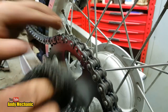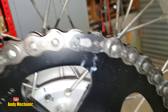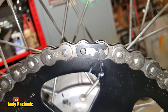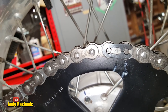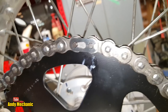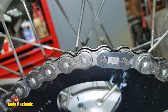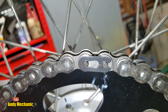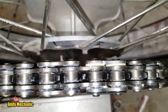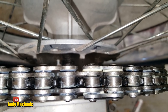And it's important that you make sure that it's in place. So let's have a really good close up. All right, bit of freehand, here we go. Is it okay with the light on? I think it is. Yeah, you can see really well what's going on. So that is bang on. It actually helps me because I'm blind these days. That is exactly how it should look. Clipped all the way on, and there'll be no gap here on the spring clip. That should be completely closed, and that's indicating that the clip is on correctly. And there you go, that's how it should look from the top. You see the little O-rings are all in the right place and everything. Plenty of grease, can't go wrong.